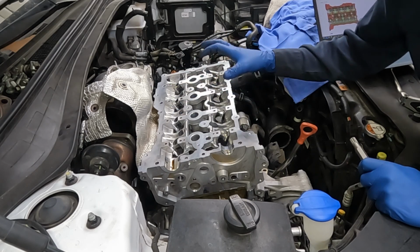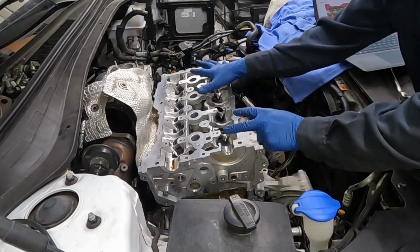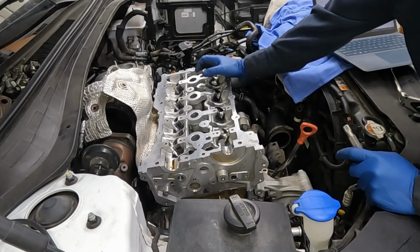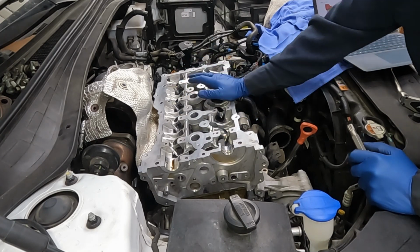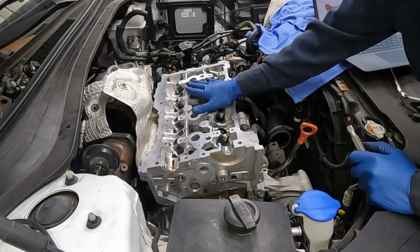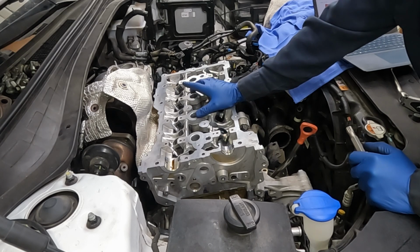Because as the head gasket is compressing, your initial bolts won't be as tight as everything is sinking down. So go through it once, 26, go through it a second time, 26, and then go through it a third time just to be 100% sure that we are starting at 26 foot-pounds. I might've said 36 in there. I meant 26 if I did.